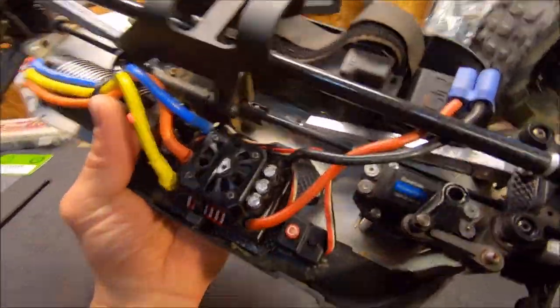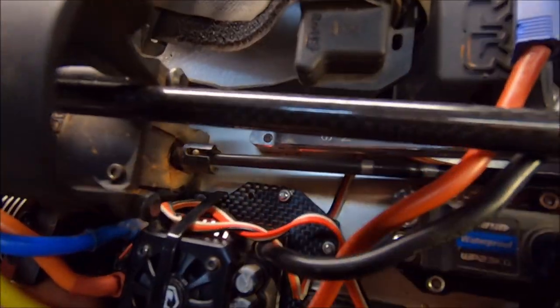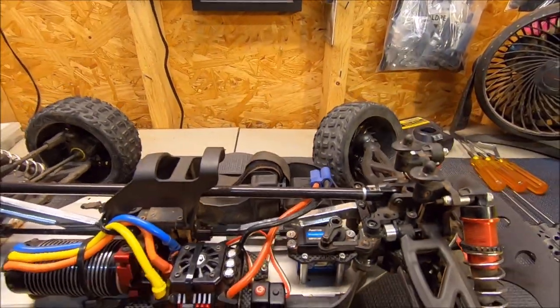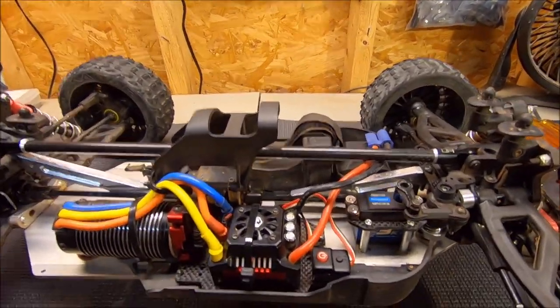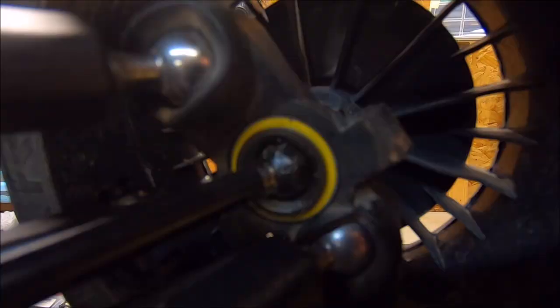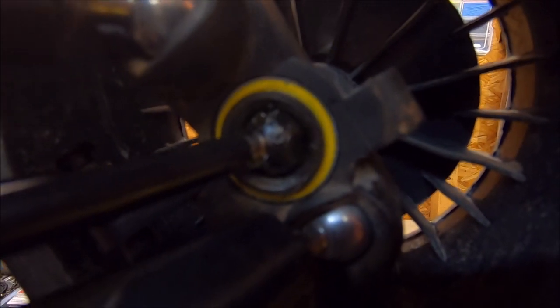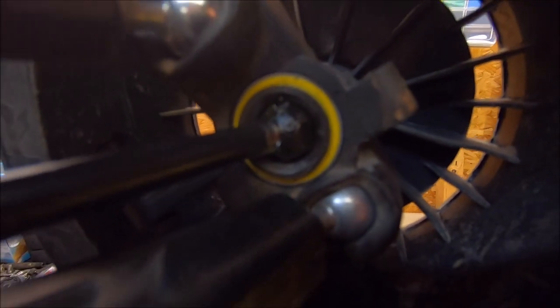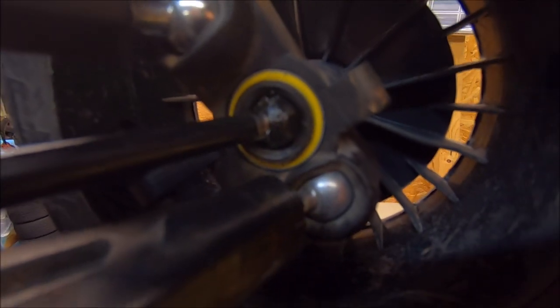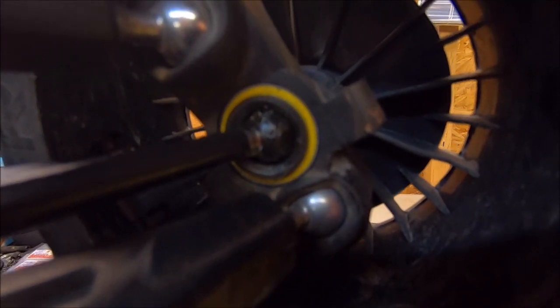I've had no issues with these bending, so it's definitely a must in a long wheelbase like this. If you're going to build an XL version, the front drive shaft has been shortened two millimeters to allow for some chassis flex, because some guys with a similar build were having issues with the front drive shaft bending from chassis flex — that pretty much eliminates it. Also got another awesome set of ABEC 5 premium rubber-sealed bearings from Garrett Howell — check out his eBay store, Definitive Solutions. I'll put a link in the description.